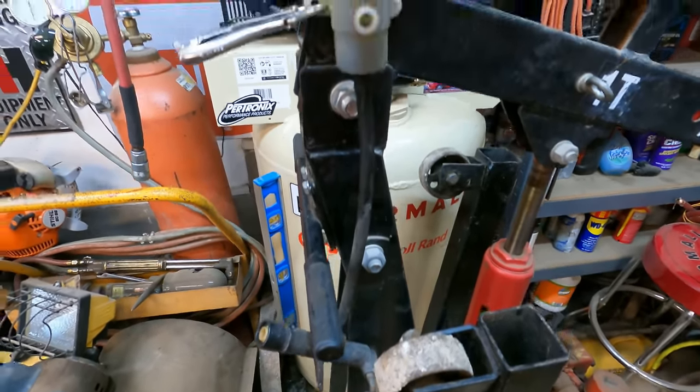That's it. Well, I'm usually not the type to give up on a project like this, but I really just can't see this being worth my time. To change out the slave cylinder, you either have to pull the transmission or the engine. It makes more sense to pull the transmission, but it's such a pain. I really don't see this truck selling for much more than $800 to $1,000 anyways, with or without that clutch working. We should still be able to drive it.